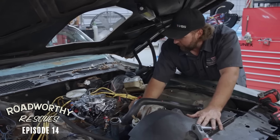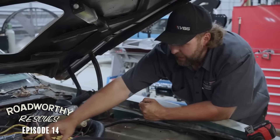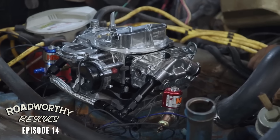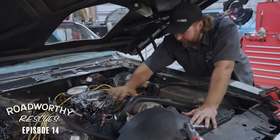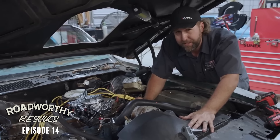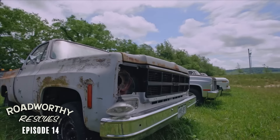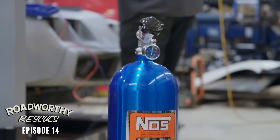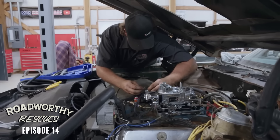This is how we're going to add horsepower. We've got a fuel solenoid up here and a nitrous solenoid back here. Out with the Quadrajet, in with this Brawler Street Series — this is a 650 CFM vacuum secondaries electric choke unit. And this is a PowerShot system by NOS. Basically we're going to press a button — this comes preset at a 125 horsepower shot. That's a lot of nitrous for this engine, but it's what we got and it's going to be pretty fun. We need to run the nitrous oxide line back to the trunk, mount the tank back there — we've already got that full. Then we've just got to wire in these solenoids so they both fire off at the same time when I hit that blue button.